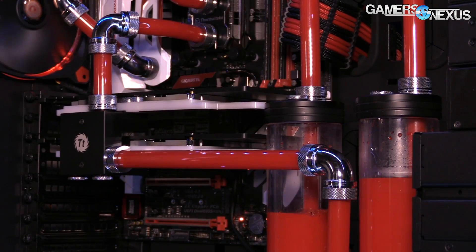From thermal testing, we've learned things like fan positioning on the top of the case — you normally have two slots on the top. In some observational tests, at least with NZXT cases, putting a fan in the top back can sometimes steal air in an undesirable way from an air cooler on the CPU. You'll have to try it with your different CPU coolers and see what works best. My main advice is to try it in the top back, then the top front, and check with AIDA64 or some other software to see what performs best, then just change it accordingly.